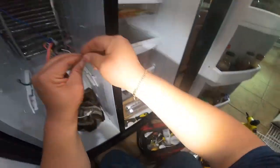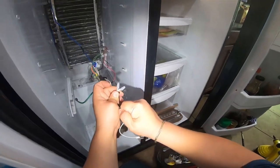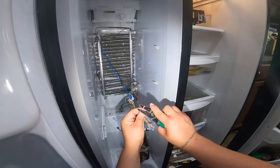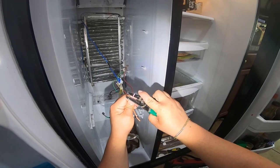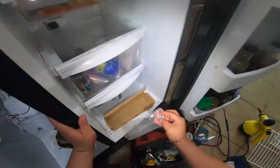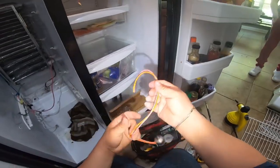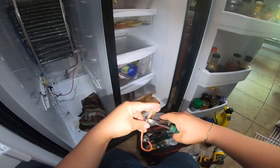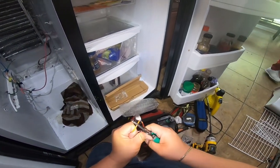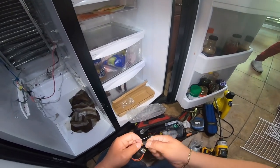Twist the wire nuts on — there are different ways to do this connection; if you prefer soldering, go ahead. I put a zip tie to keep the wires together so they won't disconnect from the wire nuts. Now I'm stripping the wires for the defrost thermostat — remember there are pink and orange wires. The defrost thermostat tested good, but since it comes in the kit, might as well put in a new one so I don't have to come back in a few weeks. The price for one part is basically the same as the whole kit, so common sense says replace all three.